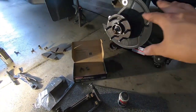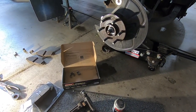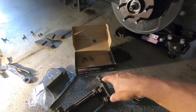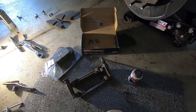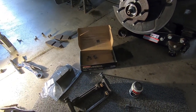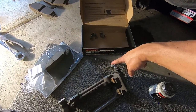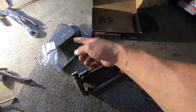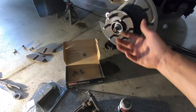What kind of sparked this whole project wasn't the fact that my brakes are fading - I probably had 10,000-20,000 miles left on them. But I was getting a chirp, and that chirp is pretty evident that one of the caliper pins is dry and I need to re-grease everything. I figured if I'm going to dive into everything, I might as well just do the brakes while I'm in here. So let's get the pins greased up, get those clips installed, get them painted, and I'll show you how to load the pads, get the new rotor on, and then reverse all the instructions.